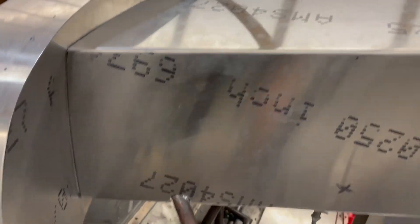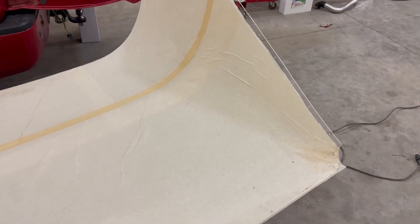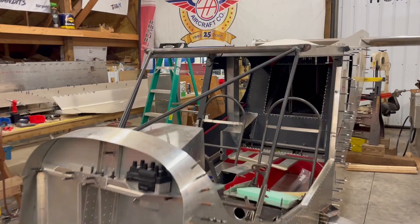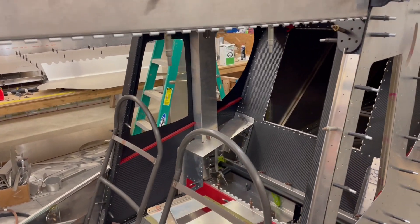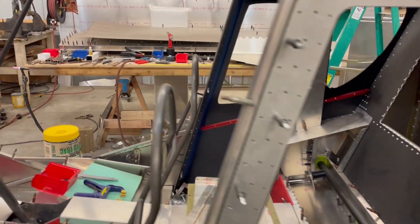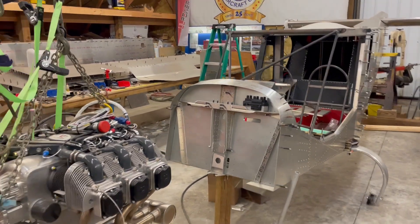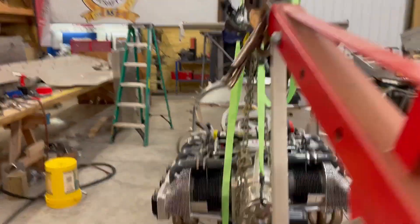I've had to cut and trim and get stuff custom made and fabricated, which has been a bit of a challenge. One of the things I've been working on the last couple of days is the windshield — it's been a challenge to get it to fit the way I want. The corners spread just a little bit wide for the chrome-moly tubing on the cabin frame, so I've been using a heat gun to heat-relieve some of that. The problem I've got is I'm making so many crazy modifications. If you want to build an airplane and don't want to spend an astronomical amount of time, just build it according to the plans. I've kind of backed myself into a corner with this custom short engine mount — it's making things incredibly tight.